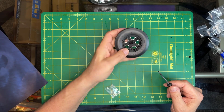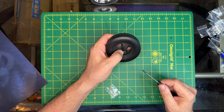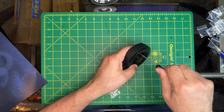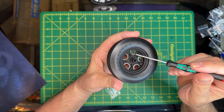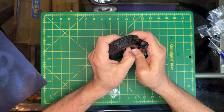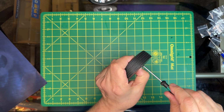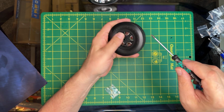All right, so you have to be careful when connecting these inner and outer wheels to the tire. Like I said, this tire rubber is pretty hard. And there was a significant gap between these lugs and the inner tire, so you had to use a lot of strength to get them touching, so that the screw could be started, and then I inserted the rest in a crisscross pattern.